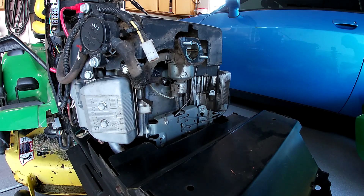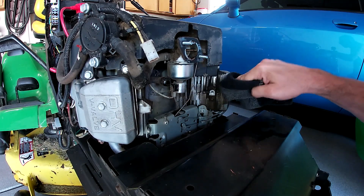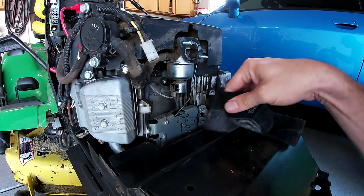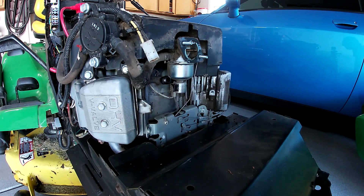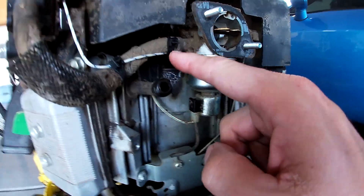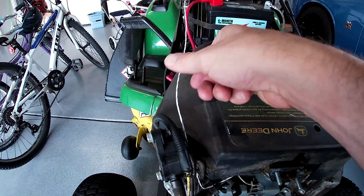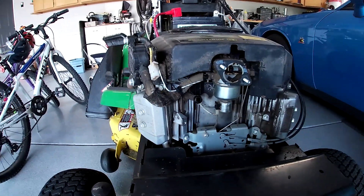Okay, here we are. I've never had this off before — there's some grime in here, so I'll just try to clean this up a little bit. Then I've got to find a place to mount this thermocouple, back behind the carb. I need to get it in there without disturbing the linkage. I've got my thermocouple zip-tied in place — I just ran it along the fuel line and tucked it just behind the carburetor in kind of open air, making sure it wasn't touching any metal. Then I can run the thermocouple wire up through under the hood to my multimeter.